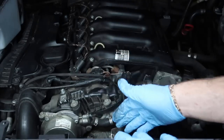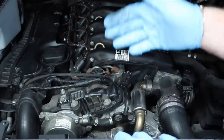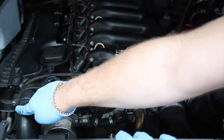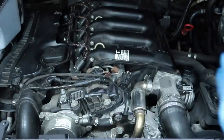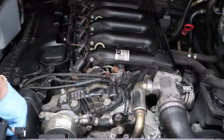We're going to get on and remove it. I am also going to take off the viscous fan, and you're going to need two 32mm spanners because you're going to have to lock on the water pump and lock up the fan as well to remove it. Let's get it all out so I can get to the EGR, and then we're going to take out the turbo intake pipe as well, and get the EGR system completely out.